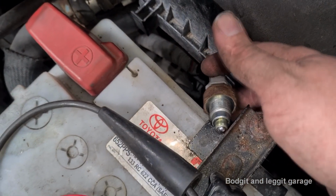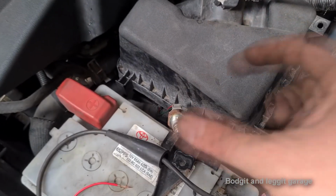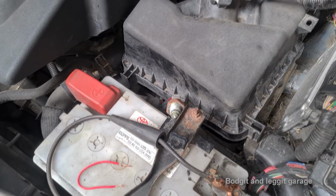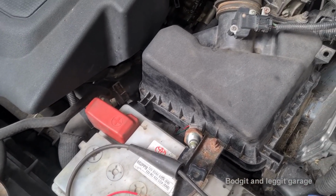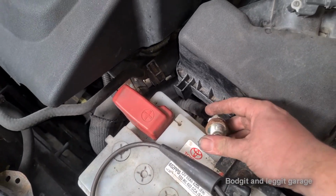So for someone who has checked that switch and said the bulb was faulty, the bulb was working, but it's just too loose in the socket. And that proves that the switch is just dodgy. So this is why you need to listen to customers, but also not listen to them.